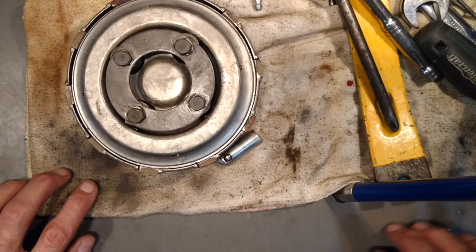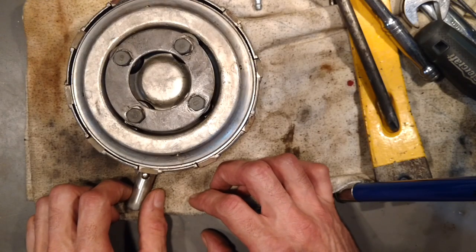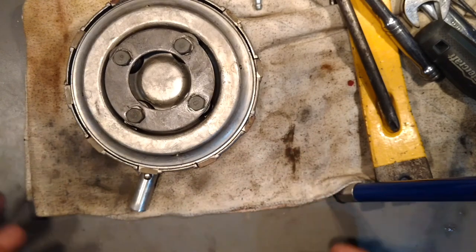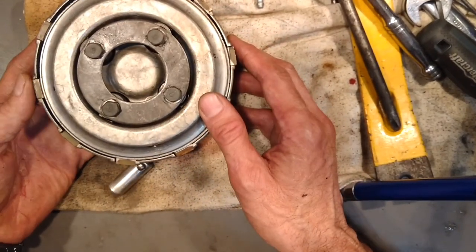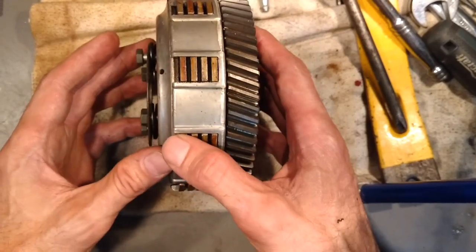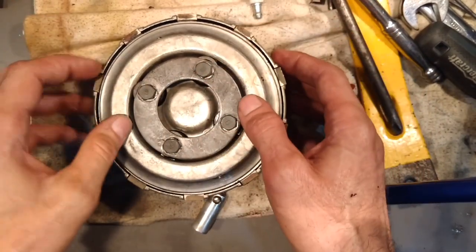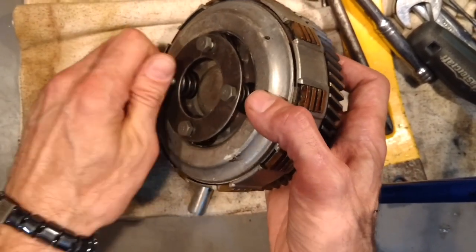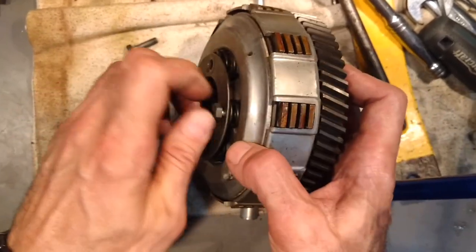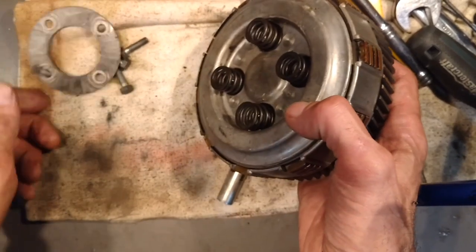One actually quite recently — the clutch was stuck. So rather than pulling the clutch all apart, I'm going to show you what that involves. For those of you that don't really know clutches that well, they're spring loaded. They're under constant pressure. Stationary, as the bike just sits there, the clutch pack is squished together. If you look at the inside of the clutch pack, you can see these springs. See the spring behind the plate? Obviously this engine hasn't been together in a long, long time. These are just spare bits that I've had kicking about the shop.